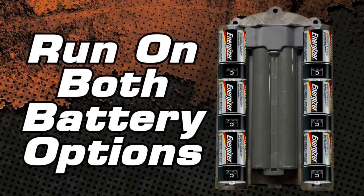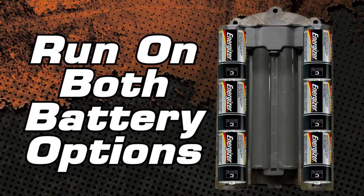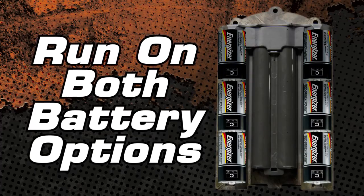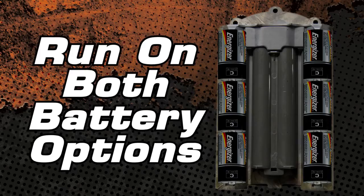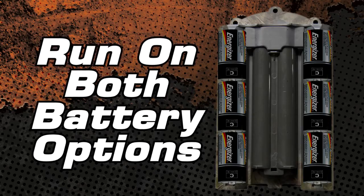If you use both Alkaline and the Extenda-Life pack together, the camera will run on the external Extenda-Life pack until depleted, and then automatically switch to the internal Alkaline C batteries. It will always run on the external pack first when both battery sources are installed in the camera.